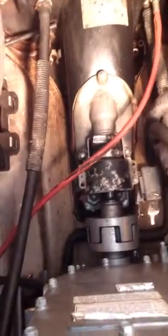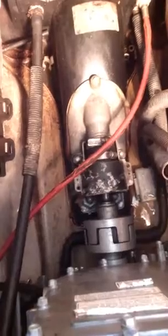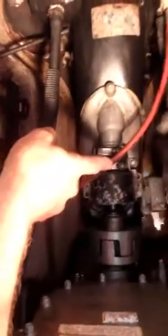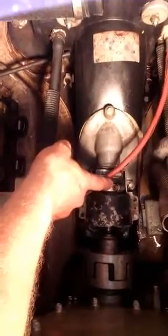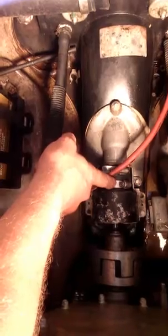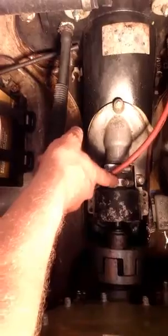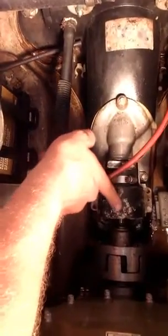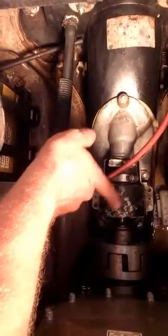And this is what you have left here. Those two clamps are going to have to come off, because that rubber sleeve where those two clamps are, that front clamp is where I think this one is leaking, or that other one that I was showing you before. Underneath this clamp and this rubber sleeve is what clamps to the bearing assembly, or the bearing housing, and I think the water is getting between this rubber sleeve and going over the top of the bearing housing and underneath this rubber bushing and coming out the front